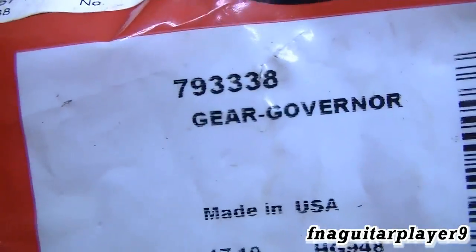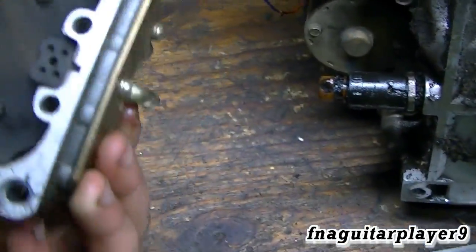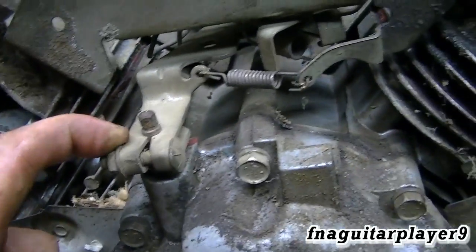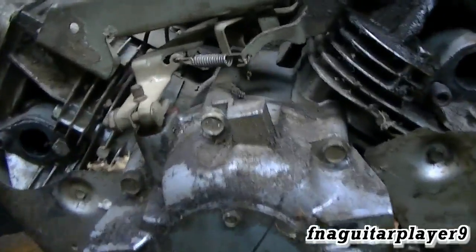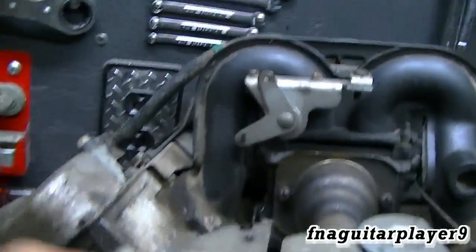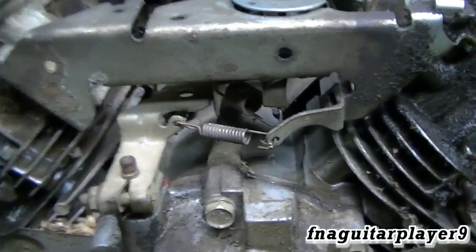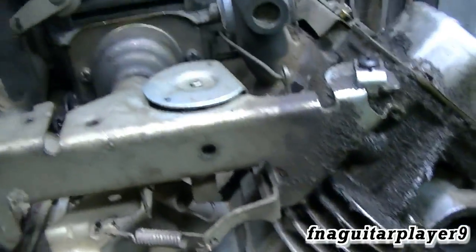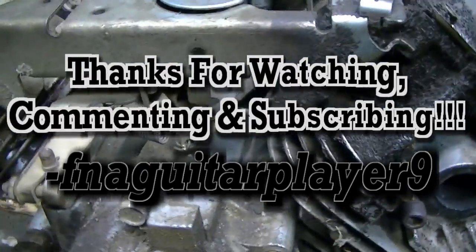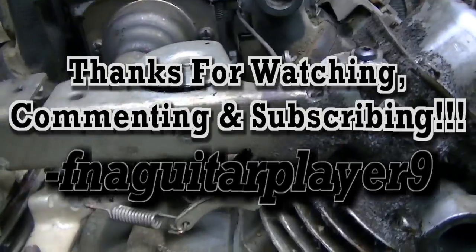There's the part number for it just in case — it's about a 15 to 20 dollar part. You can get an aftermarket carburetor for around 40 to 50 dollars on eBay. Like all small engines, you adjust your governor the same way — I have videos on that, not on this particular engine, but it's the same process for 99% of small engines with a mechanical governor. That basically sums up all the linkages on this engine. I have other videos on single cylinder flathead and overhead valve engines, and I also want to make a video on the opposed twin. If you have any questions about governor, throttle, or choke linkages on any of these small engines, leave a comment below. Thanks for watching!